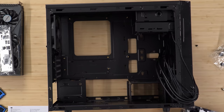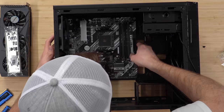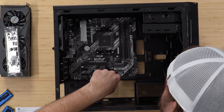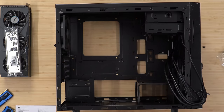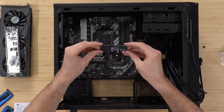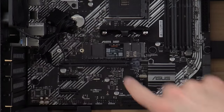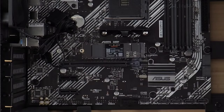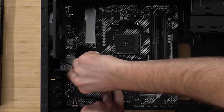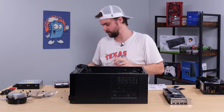Let's go ahead and mount the motherboard first. I got all the standoffs mounted — it came with two standoffs already mounted for some reason. Got that in line, though I was missing one and had it in the wrong spot, so I moved that. Got the standoff fixed and slid the motherboard in. Next up, we're going to put the M.2 SSD in. We slide it in place, it clicks in, and we push it down and mount it — the standoff and screw fit perfectly.